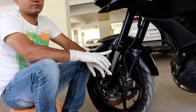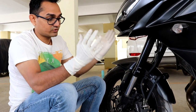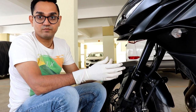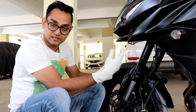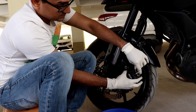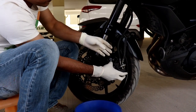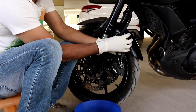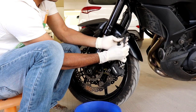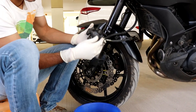Remember you should not press the brake when you're taking it out, otherwise the pistons will pop out and pushing them back in will be a big pain - you'll have to bleed the brakes and reset it because air will go inside. That's why I suggested taking out the ABS sensor first - now it's easy, otherwise it gets stuck.